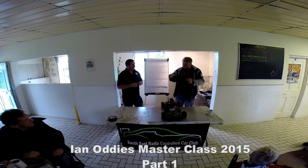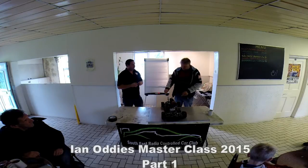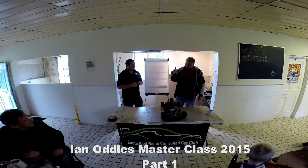You need to try and get the roll control of the car on the front, because the back end is trying to keep it back in line going around the corner and also drive the car forward. So these tyres are doing 2 jobs. Those are just pointing it, and on the straight they're doing nothing. So the back is always the softer end.